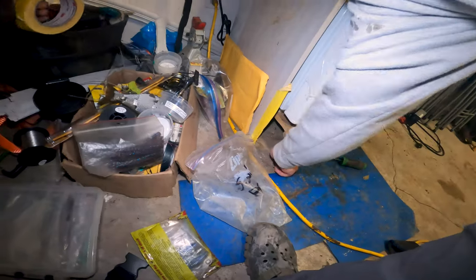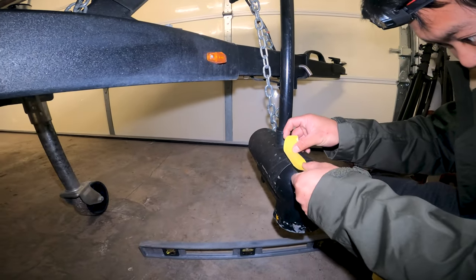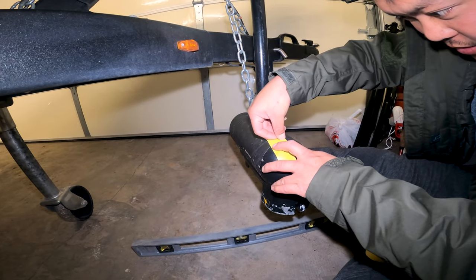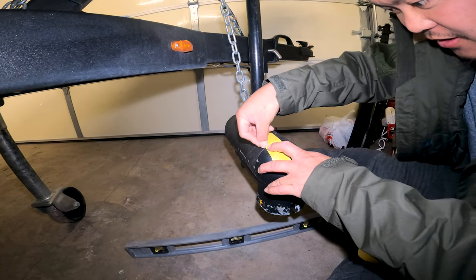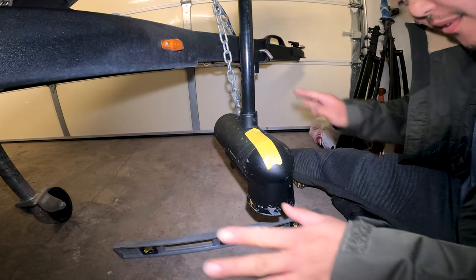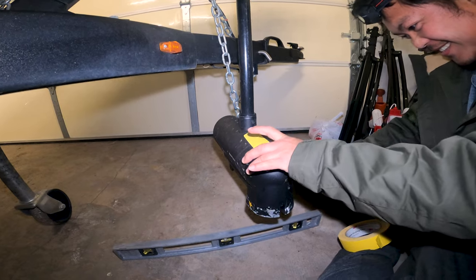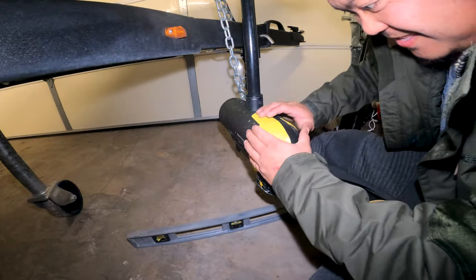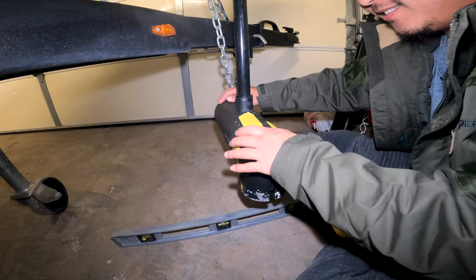You can put a scratch on it, or you can just tape it together so it don't move. But if you line this tape up, it should be where it's supposed to be. It's supposed to be just perfect. Just tape the rest up. Hey, this is not a professional shop. Don't laugh at us, because you know you're going to do it too. It's just our alignment tool. That's the best we could get.